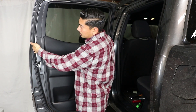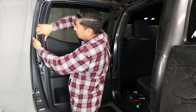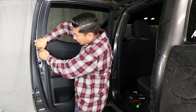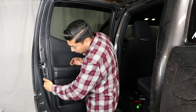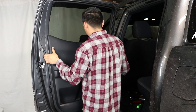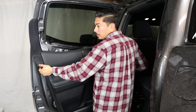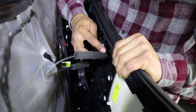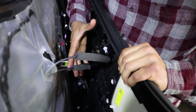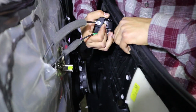For the next section you can use a panel removal tool, or just use your bare hands. Start where there's a little bit of room, squeeze your hand in, and remove the top piece — be really careful because the clips break easily. Work your way around, popping it off. Once it's loose, bring it up slowly. Don't tug on it — the cables for your door handle are running through there, so grab over the plastic and carefully pop it off.